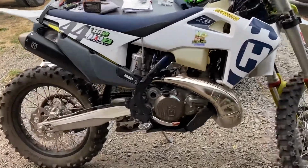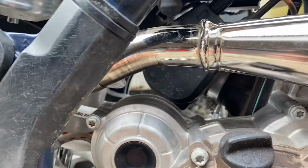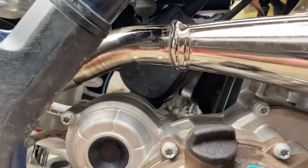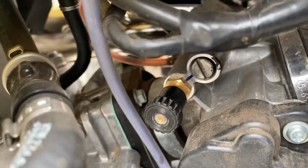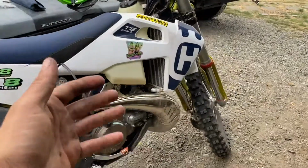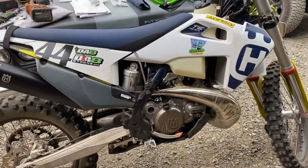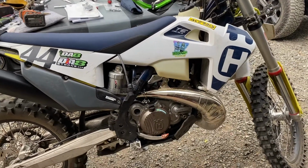So after you do the throttle body mod, and you take this cover off and pull this off, you heat the screw up and you put the screw in the bottom from Slavens Racing or Best Dual Sports. Then you come over to this side right over here, and you can tune that screw right there. You can tune that up, and then that gives you AFR. You can also change the fuel pump on this, and the fuel filter and stuff from Best Dual Sports.